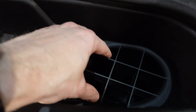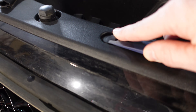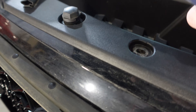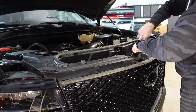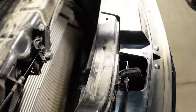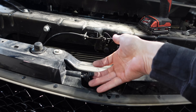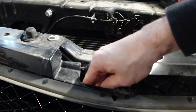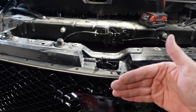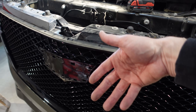I'm just going to remove this plastic trim here, which feeds into the air intake and just kind of blocks the radiator area. There's a little cap here you have to pry up first, then get underneath it, and then just remove all of these. What this has allowed me to see is we can see the backing plate in there and I can see all of the tabs that are holding the backing plate in place. I'm not fitting my hand in here, so I'm going to undo these six bolts right here that are holding the top of the grill. Then I should be able to pull that forward a little bit, get my hand in there, and depress these tabs so I can pull this back plate off.